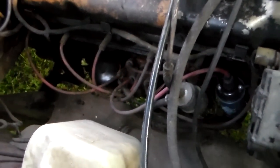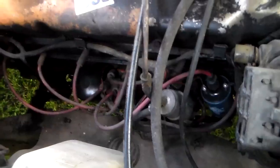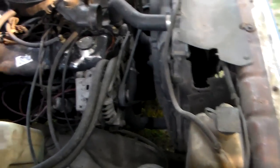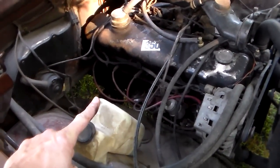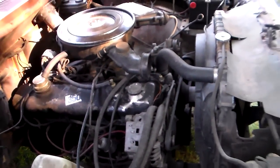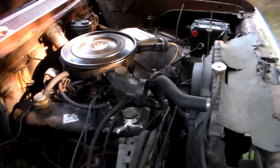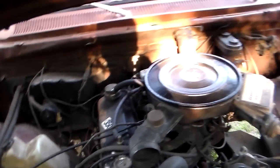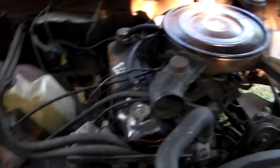You don't have to change the cap or plug wires, but you do have to pull the distributor — so be familiar with distributor swaps. One of the great benefits of this HEI swap: the standard ignition runs a plug gap of about 0.035 inches, but with the HEI system you can open the gap up to 0.045 inches — that's 0.010 more gap — so the engine should run noticeably better. Just make sure to disconnect your battery, put the vehicle in gear, and have your wits about you.